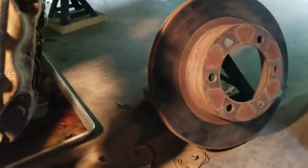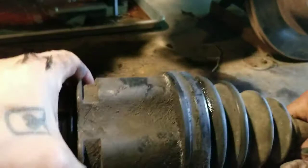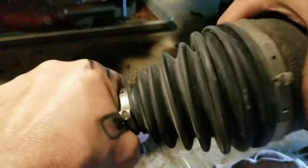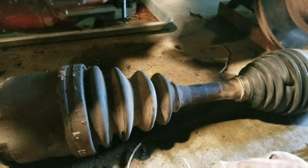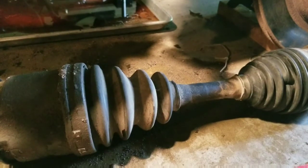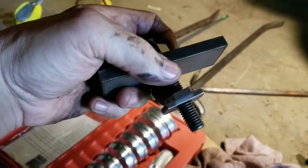You can check your CV — stock CVs or aftermarket CVs. They should have some movement in and out — that's how they flex — but they should have no clickies or roughness when you wobble them or try to turn them. This one is in great shape, there's no clickies, no weird noises. I'm going to put this right back in. I bet if I wipe all the grease off this it's probably got the blue dot which shows you it's a Toyota. I'm going to let that drip grease for a minute, get my removal tool set up, show you how to put that in there, and we'll get this thing out and switched in no time flat.